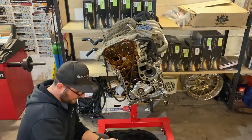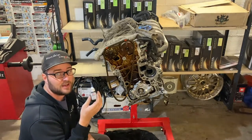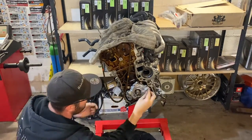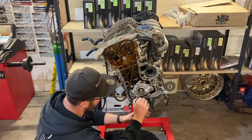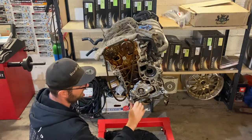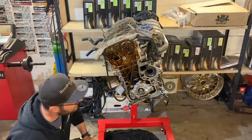Brand new pump — getting the screws back in. Although it doesn't say it in the Toyota workshop manual, I like doing that especially when it's parts that could come loose or that have tiny screws. I like to put some Loctite onto the threads around the oil pump. These bolts have to be tightened to 9 Newton meters. I like to tighten things in a crossed fashion — there we go, and it's all back together.